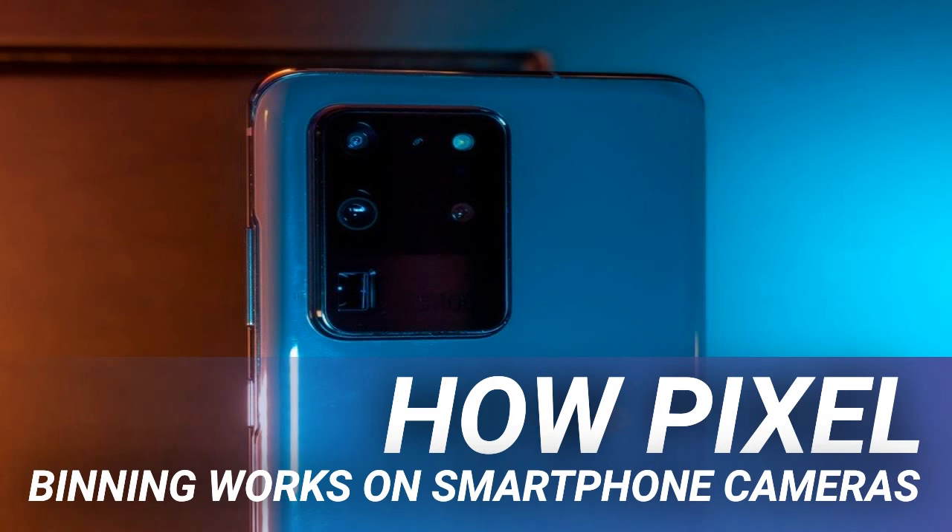All of this creates a trade-off that manufacturers conveniently don't mention when marketing their phones. While binning can help provide two shooting options from the same sensor, they aren't otherwise working in tandem. For example, when you shoot at a resolution as high as 108 megapixels, you're capturing a lot of detail in each frame — so much so that you can crop in a lot more than you ever could with a 12-megapixel shot. The catch is that you need to shoot at the full resolution in optimal conditions where light is bright — think daylight or really well-lit indoor environments — or else you may find they turn out dark and dull.